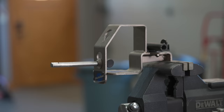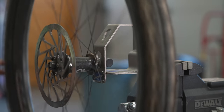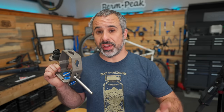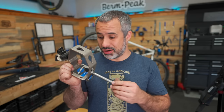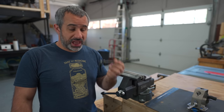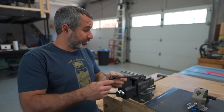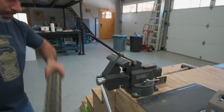This Park Tool wheel holder — I use it just about every single day and honestly thought it was kind of silly when I first saw it. But having a way to hold your wheel safely while you're installing a rotor or mounting a tire is really convenient. And as you might imagine, there are several ways you can rig one of these up yourself. Quick and dirty: if you've got an old through axle you don't care about, there's more than one way you can clamp it in the vise to hold the wheel.